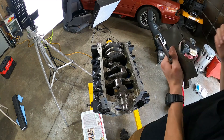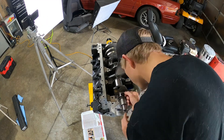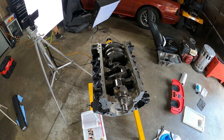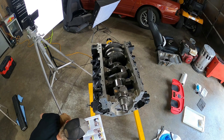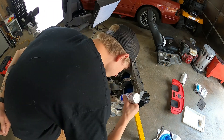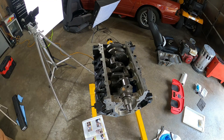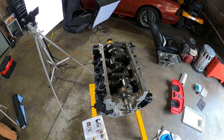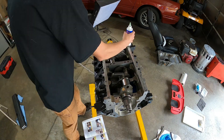A lot of talking here, I know. Now that that one's done, I'm going through and pulling the rest of them off, double-checking all the tolerances of the squish as I go. Then I take a plastic razor blade — so it's super soft and won't mark up the crankshaft — and scrape off all that plastic. Got to do the same thing to the main bearings. Then some nice Lucas assembly lube. I set the crankshaft back in, lube up the crankshaft and the main bearings for their final assembly.